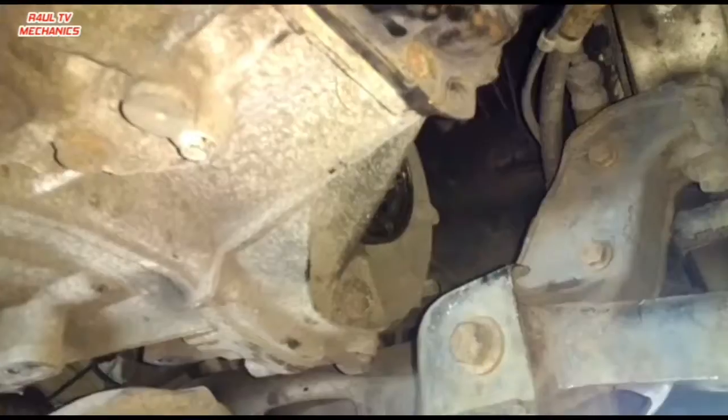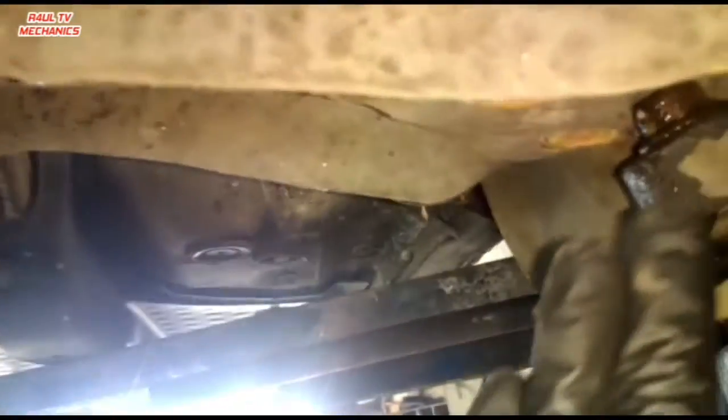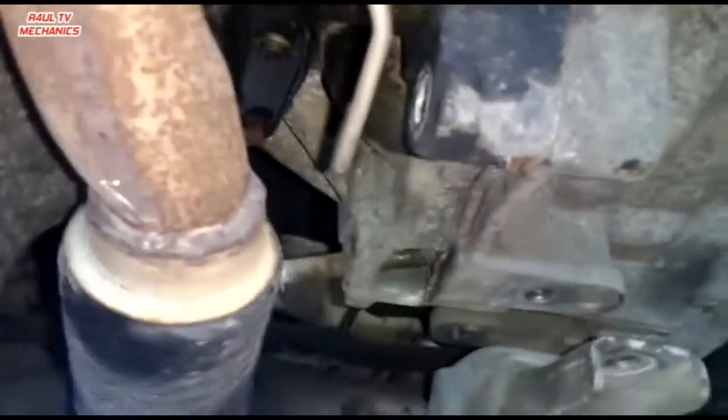Up on the ramp, we're going to put this mounting back on first. First things first, put this one on, it centralizes everything. We'll put the drive shaft back on, the ball joints back on, like I mentioned, the starter bolt, tighten that up, go through everything, basically everything in reverse order. Let's go, let's do it. Everything is back on again.